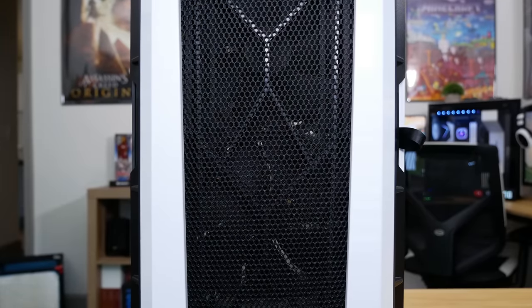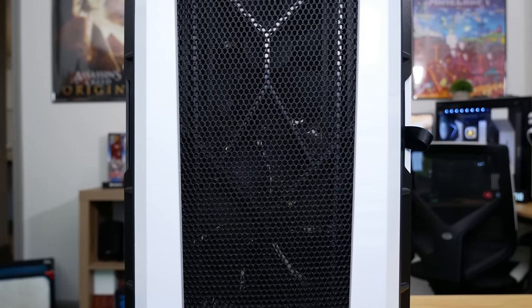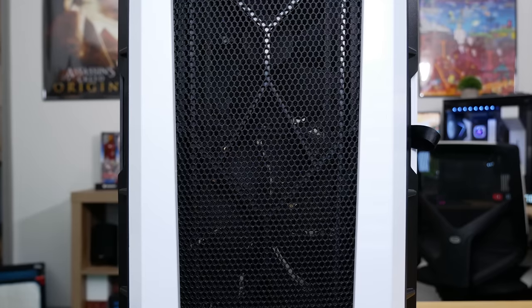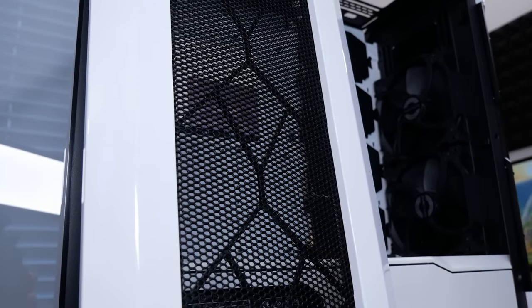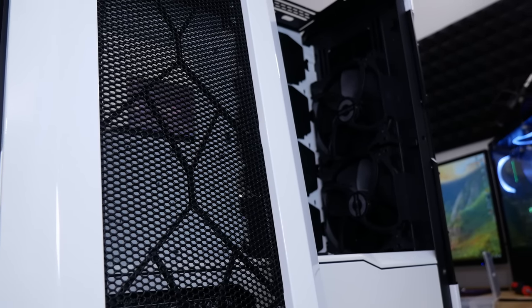What I really want to talk about is this nylon because it's something I've never seen before in a PC case. We saw this in earlier stages at Computex — Phanteks wanted to play around with it, see if they could implement it into full-scale production, and here they are doing that. They were claiming three times the airflow of conventional mesh filtering. I wasn't totally on board with that until I ran our stress test. The P600S has the best airflow of any case I've ever tested in the config that we tested it in. The nylon kills two birds with one stone — it filters larger dust particles and hair while occupying a significantly smaller area, meaning air is less impeded when pulled by the front fans. It doesn't comprise a single sheet the way a metal filter would — it actually looks like it's interwoven twice, two nylon layers stretched to spec without glue or anything that could break down with time. You can clean it pretty easily and even potentially replace it with other colors in the future.